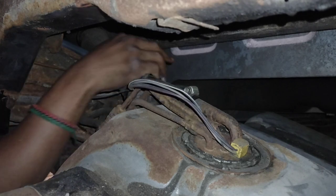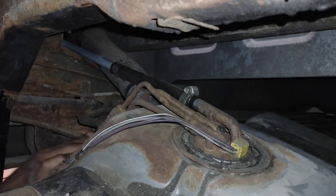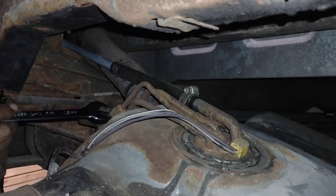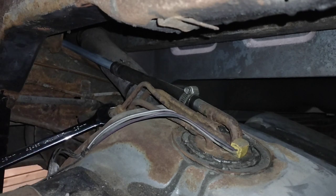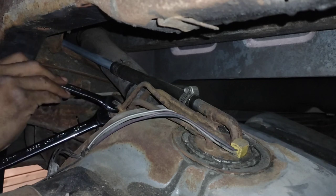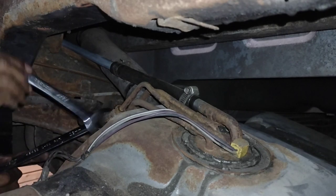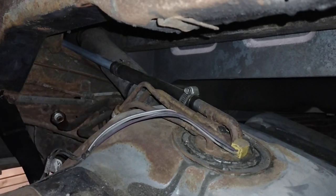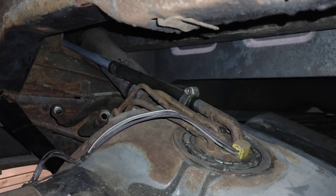Now I have room to work and I can disconnect everything. I need some wrenches - a 19mm for the larger nut and a 16mm for the smaller one. There are two identical connections: one for the fuel return and one that is the outlet of the fuel pump. There is also another small tube held on with a hose clamp - just get some needle-nose pliers and you can take that off pretty easily.